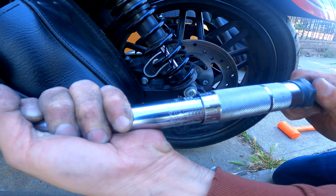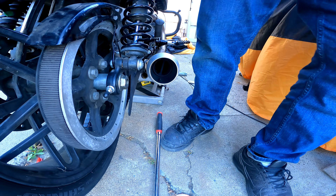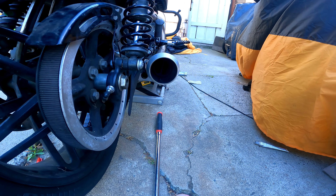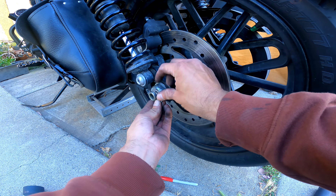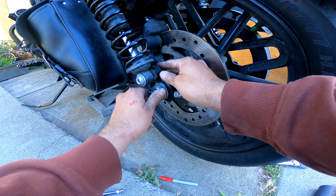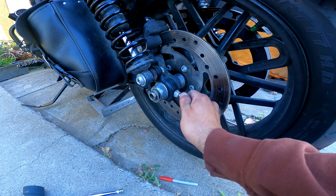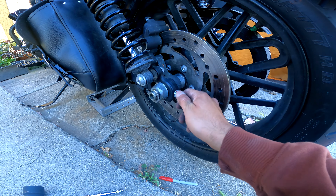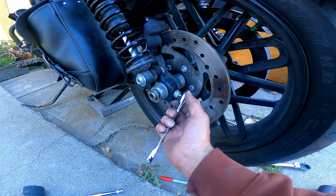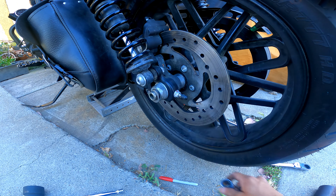This is now loose. Now it's time to balance the wheel so there's enough weight on it so I'm not struggling trying to get the axle out. We have the jacks down. The bike is lifted — there's just enough weight on the rear tire that it was moving, so I lowered it back down a little bit until it touched. Let's grab the mallet and give this a few whacks to see if it pops out. If it doesn't, we'll lift the bike a little bit more.